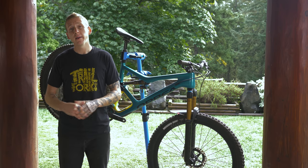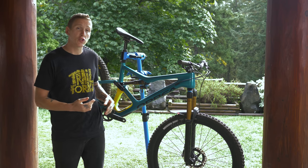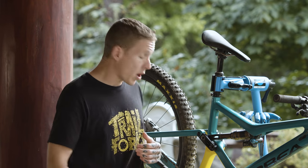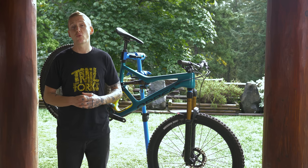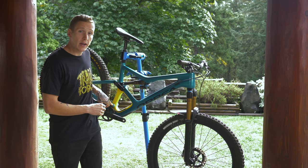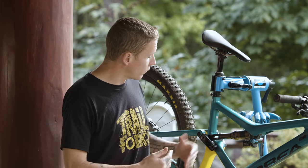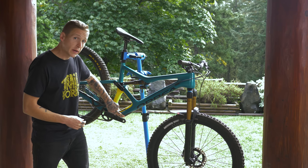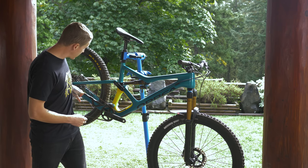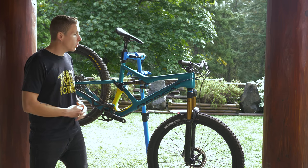We're just going to take a look at some frame details. The most obvious thing is this single-sided frame strut — on the left side, it's completely open. Down here, there's a threaded bottom bracket, but there are no ISCG tabs on this bike. Instead, Orbea uses a direct mount chain guide right here that mounts on the main pivot. Cable routing is internal from front to back, giving it a nice clean look. There's a big pad underneath the down tube, and a fairly nice chainstay protector that runs all the way up — the bike has been fairly quiet, so we know it works.